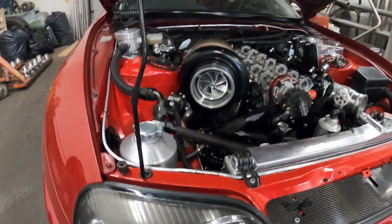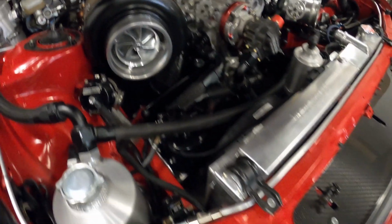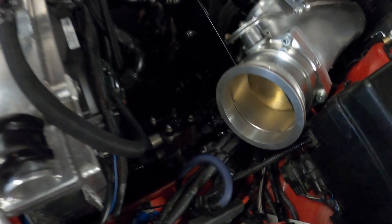So yeah, this thing's massive. There's a lot of room for the clamp there, so we're gonna have to weld the clamp right on it, and then the intercooler piping will go down under the motor plate and then makes a turn here, goes into the intercooler. And then this side I already have one piece in. I don't know if you can see it here. I took this cover off so we can work a little easier, but there's the HD clamp in there. There's another one there. And then it's just gonna go up and feed the 4-inch throttle body.